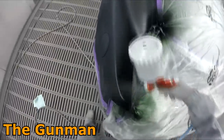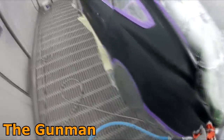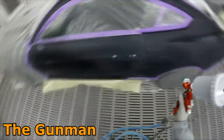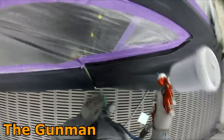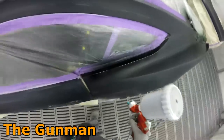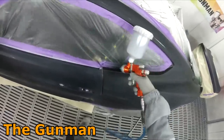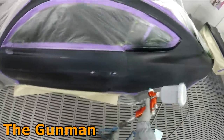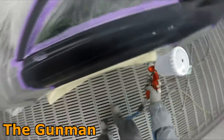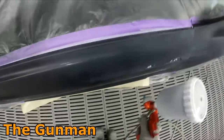I personally wouldn't do it every day, like it wouldn't be my preferred clear cap, this aqua cap that I've got on here, and the clear coat wouldn't be my preferred base coat cap, but you can spray it fine without any issues. There was one or two little chips there that I did find when I was prepping it up, and a couple of little nicks around that door handle, so I did decide to put just a tiny amount of colour there. And because it's black, it's just covering so easy, so it's only going to need like 1.5 coats and good to clear.